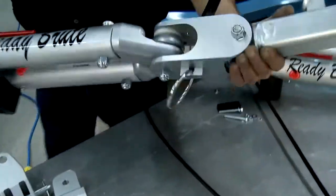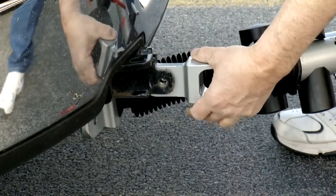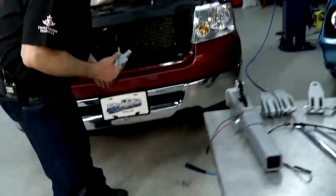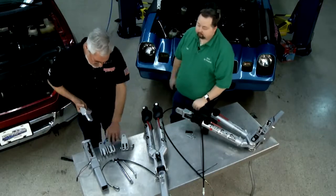Absolutely. This is an aluminum 8,000-pound towing capacity tow bar, and it will adapt to any brand of a base plate by using these clevises that we manufacture. These are billet aluminum, but they will go ahead and hook to any Demco, Blue Ox, or Roadmaster base plate. So you just tell us what kind of a base plate you are going to use, and we'll send it out the door with those on it. Okay, so if you already have a set of base plates on a vehicle, sometimes you buy a tow vehicle, it's already got them on here, and that's these deals right here that you saw me tying up in the front. Their clevis goes right in there, pin goes through it, got plenty of pivot that way. And if you have somebody else's base plates, you can adapt this to anyone. Absolutely. Using these different styles of clevises.